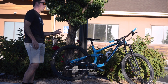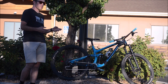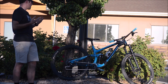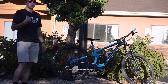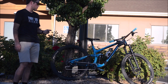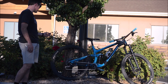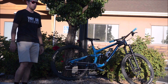The wheel build is also something I really like — a nice touch by Transition. It's the E13 TRS rim mounted on Novatec hubs. Novatec has been around a while and makes hubs for a lot of companies — they're known in the road world for some pretty good hubs. This wheelset has been awesome and really strong. The E13 wheels are easy to set up tubeless; they come pre-taped, so all you need is a tubeless valve. No dents, still perfectly true — I've never had to true them in the six months I've had the bike. The cones haven't been coming loose either. They've really put up with a lot.